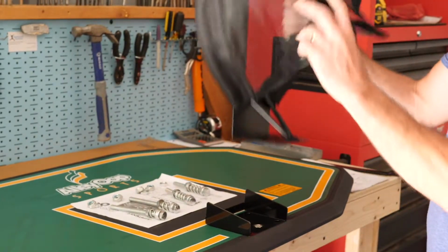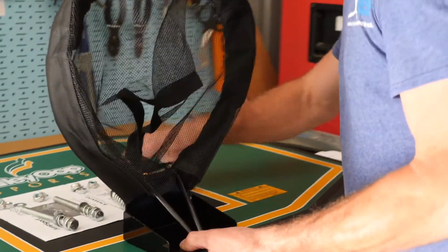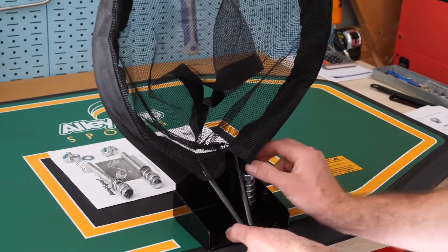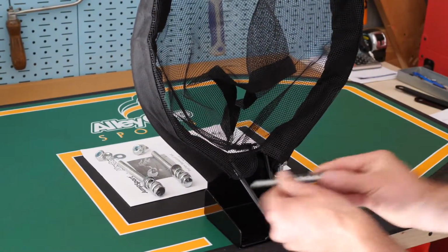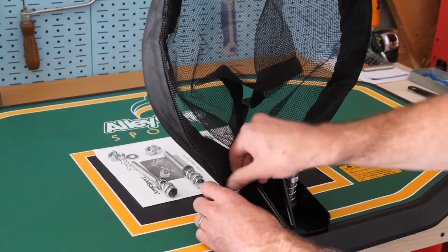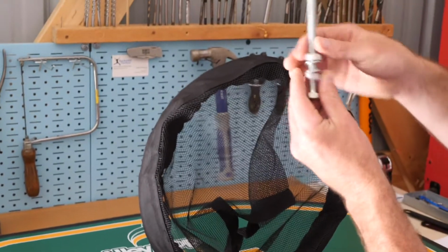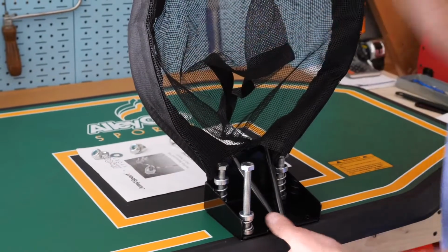take the rim here and set it in there. Take the 100mm bolt and drop it in, top hole there. Just like to hand tighten it. Take the other 100mm bolt, same thing on that top side. Just get it hand tightened right now. And then take the 125mm bolt, same setup with the spring, 2 spring washers on there, and the bottom side. Hand tighten that.